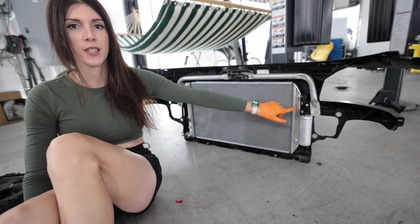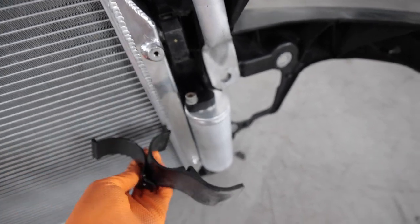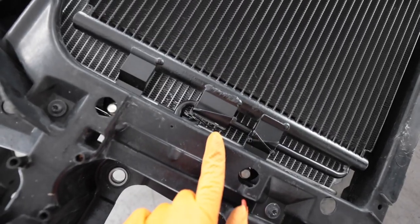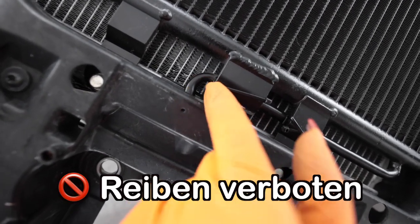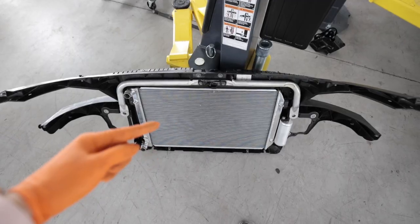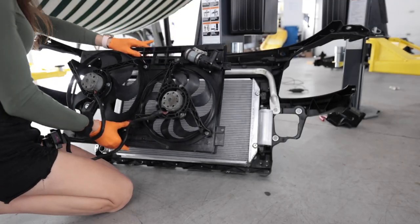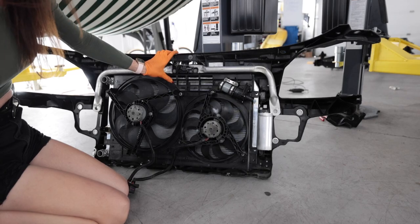I had to do a little bit of custom modifications to the AC condensers — the same thing I had on the previous one when I installed this dual core CSF radiator. This bracket right here is what would hold your AC dryer in place, but it's impossible with an aftermarket larger radiator. I took into consideration potential chafe hazards, so anywhere these hard lines pass through a potential chafe spot, I wrapped the line with some 3M double-sided adhesive and secured the line to the old bracket here so there's no wiggling or vibration potential for the AC condenser or the radiator. It's little stuff like that that makes a huge difference on aftermarket parts — whether the car will constantly break on you or if the aftermarket parts will actually be an improvement.